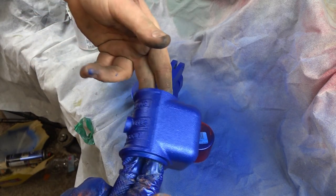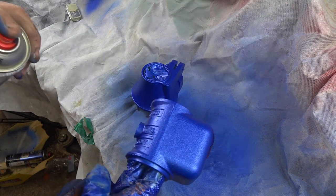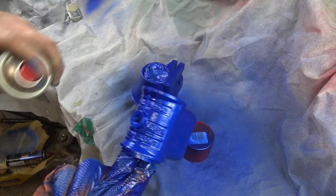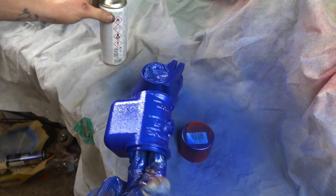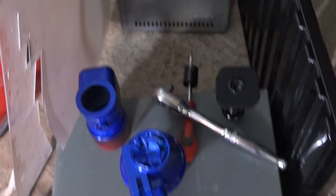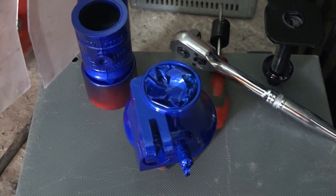Another five minutes has passed with the air dryer. Now we need some clear coat. What that does is fills all the holes on the rough surface - basically gives it a shine. You're just filling holes up with that. Watch the difference - look, it's like a sheet of glass. I prefer to do clear coat with just one thin coat. I don't start blasting loads of coats on it because it just doesn't need it. Just one half wet coat and that's enough. So basically this is it for 24 hours inside the heater, couple of boards just to keep the air moving into the middle. And tomorrow we'll put it back together.